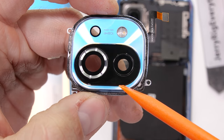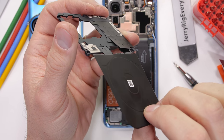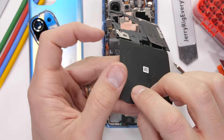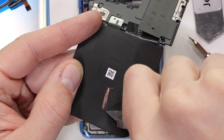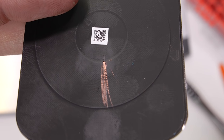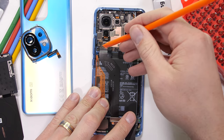Underneath the glass layer on top, it's got a dual colored LED flash. I can lift off the wireless charging coil and the NFC pad. It's impressive that this guy can handle 50 watts of wireless charging and 10 watts of reverse wireless. Most phones can only do about half of that. We can see little strands of copper inside that generate the magnetic field that allows it to send and receive power. I'll unplug the two battery connections and the two extension ribbons, all unclipping like little Legos.